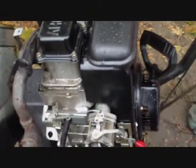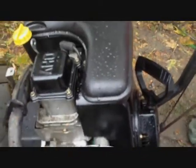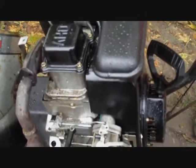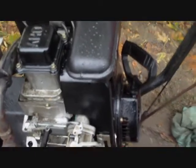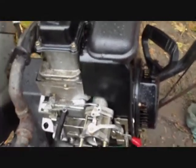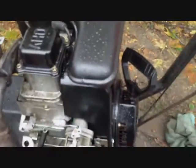I've never really had this issue before — none of the linkages are messed up. If anyone has any suggestions — I've had this problem before but I've just done adjustments. The float seems to be fine because I've had it running on other occasions and it stays running no problem. Sometimes a float gets stuck. I'm going to show you in the next video — I can't do it right now, gotta let this drain. I actually had to do the float to make it work correctly, at least it did work correctly for a while. So yeah, I'm at wit's end with this stupid bugger. I might just end up putting a new carburetor on it if anyone has any tips — it's a nine-horse Tecumseh Enduro Excel.